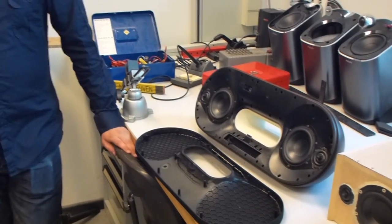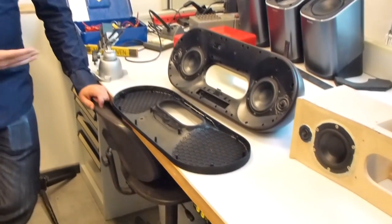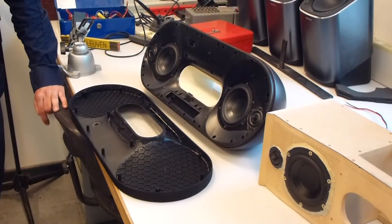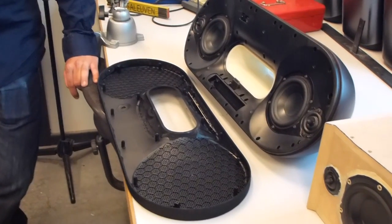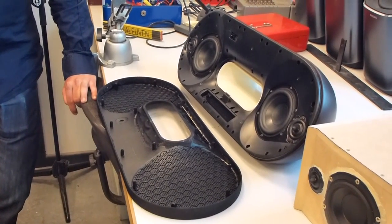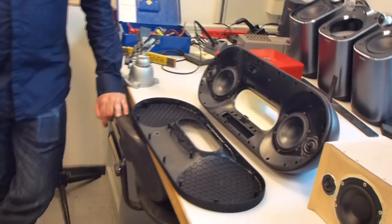In this product there's also a DSP. There is Full Sound — a dynamic bass enhancement — which helps because the speaker is still compromised in terms of volume. The bigger the volume behind the woofer, the lower it can resonate, and Full Sound can boost regions where the volume is lacking. Importantly, the DSP is also responsible for ensuring you never hear distortion. It monitors and controls distortion, especially at very high levels, by managing the mechanical movement the woofer can physically do and making sure we never exceed an acceptable limit of audible distortion. So you can still play very loud, but without audible distortion.